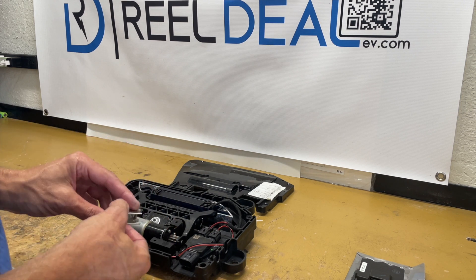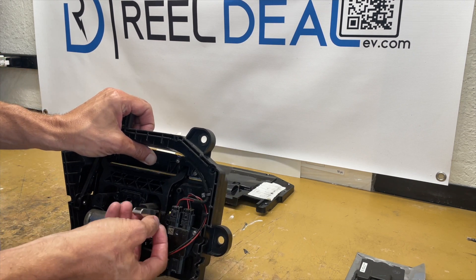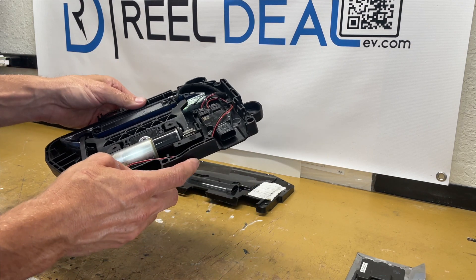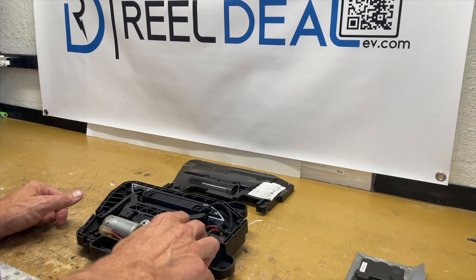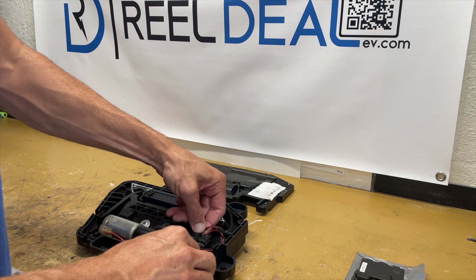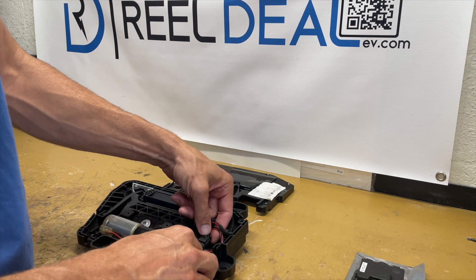As you can see here, the paddle gear is broken — there's no circle on it anymore, it's just open ends. You'll see this sitting inside the handle itself. It's a little different than a Gen 2 or 2.5 handle. You don't see the microswitches anymore; those are all gone in lieu of the Hall Effect sensor.